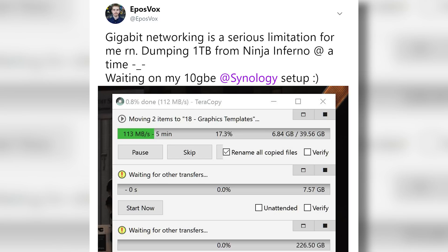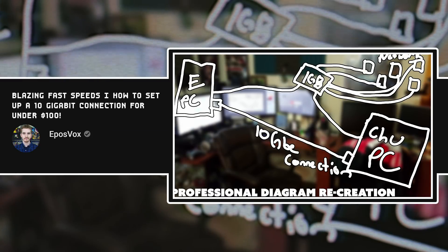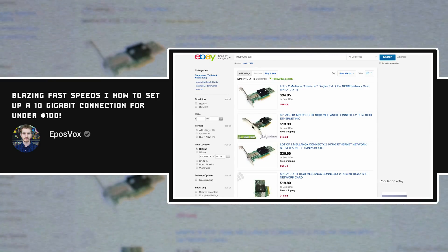With some of the high bitrate and DNX footage I capture, it could take up to an hour to transfer a small amount of usable footage to the NAS. So when we planned for a long-term solution, I wanted to make the jump to 10Gb networking. I experimented with it back in 2015, making a video showing point-to-point 10Gb between two computers, and I already had some SFP Plus network cards and cables, so I was ready to go — sort of.